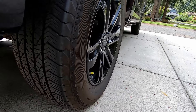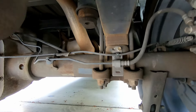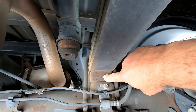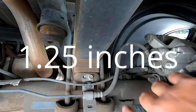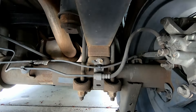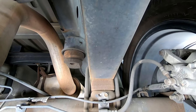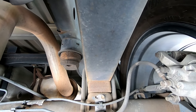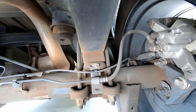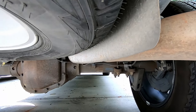You don't even need jack stands. You don't even need to take the wheel off. Basically what we're gonna do is take this factory OEM block out of the stack — I can't remember if this is an inch or an inch and an eighth, but regardless we're gonna take that out. We need to take the u-bolts loose, get them off, get them out of the way.